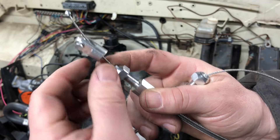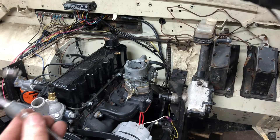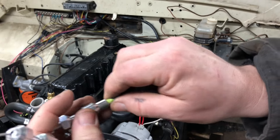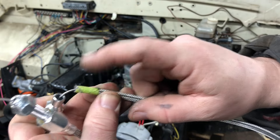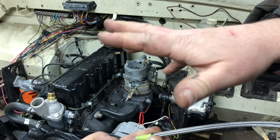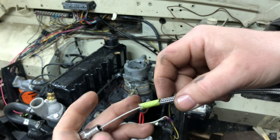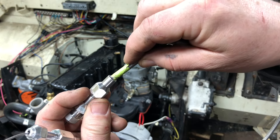The other end has a little horseshoe with a pin going through and some adjustment for a bracket. I ordered a 36-inch cable so I could cut it down if needed. When you go to cut it down, wrap it with masking tape first - I took the cable out, wrapped it with masking tape so the mesh doesn't splinter out. I then cut it with an angle grinder with a cutoff wheel, and now it holds its shape and slides right back in.